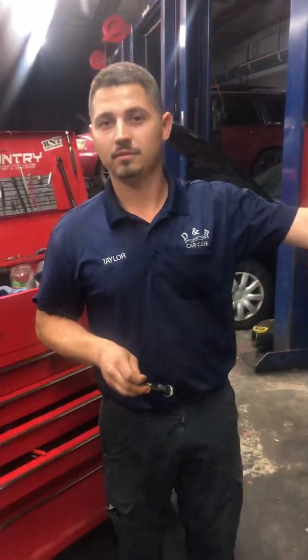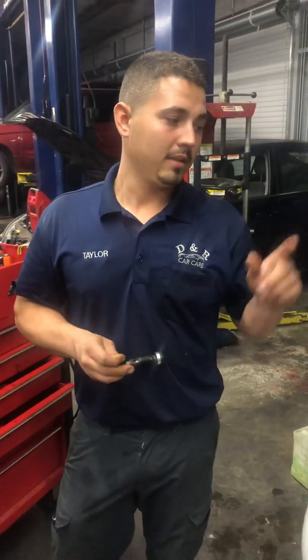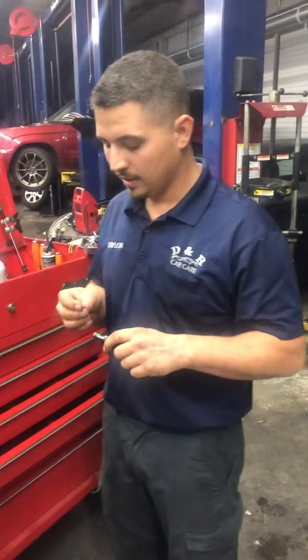All right, working on a 2012 C250. The timing chains on them are fairly trashy, and the cam hubs go bad on a regular basis. They're fairly easy to mistime. Had a technician do it today. Enjoyed going back after that.